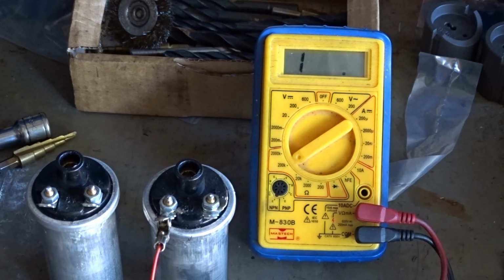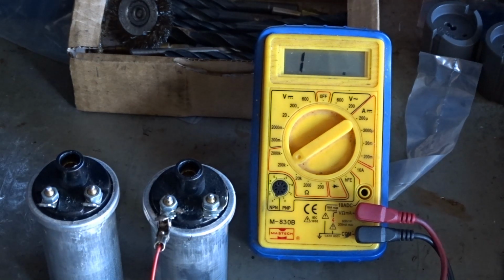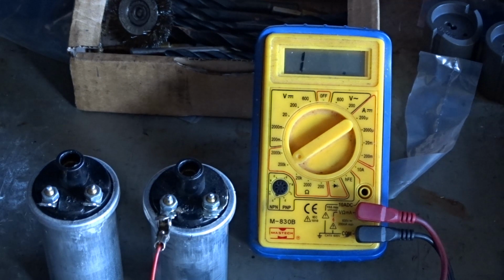Here's the two coils from the Triumph, right, and I was working out, I couldn't work out, with every different carb setup I had done on that Triumph, I'd hit the same problem with the slight dead spot at acceleration. And you trawl all sorts of things online to find out if other people are having the same problem, and I found one bloke who had the same problem as I'm getting, and he'd done exactly what I'd done. He changed all the settings, the jets, the slides, the needle positions, the pilot jets, he'd done everything and had exactly the same problem.